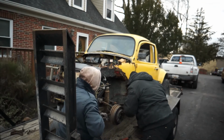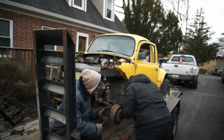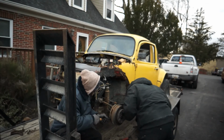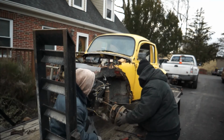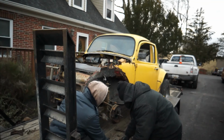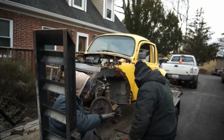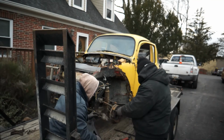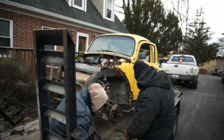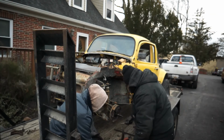So we got the top brake shoe breaking free, and I'm just gonna go around the outside gently. You don't want to bend the brake backing plate. Boom. That's the ball game, and you can just see once again the brake shoe is stuck inside the drum down here because it's sat in dirt. Mud. We're not going to worry about that right now. It's got a little bit of hardware in there that holds the shoes in place.